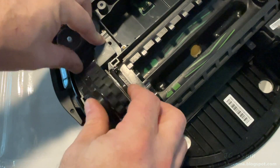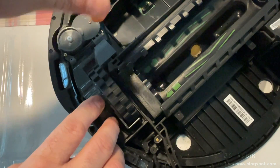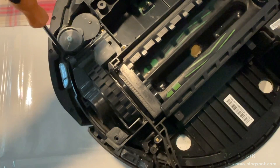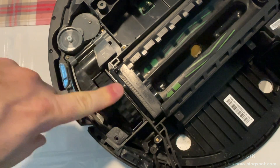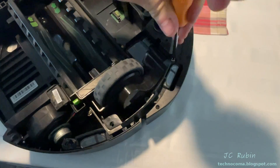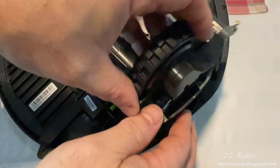I check from the top to make sure everything's uniform as I rotate the wheel, then check from the opposite side to make sure everything is seated in — it is. The whole wheel assembly is then loaded back in and both screws are screwed back in, just to remove the slack. Starting on the inner screw first, then the outer screw, and when all the slack is removed I give each screw the slightest snug down. Remember we're screwing into plastic — we don't want to break it. Check the spring action and the installation is completed, then repeat the process on the other side.